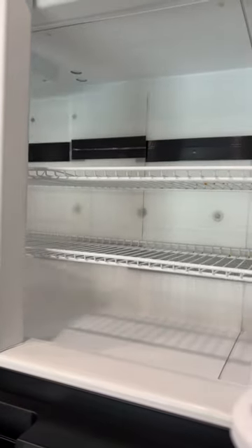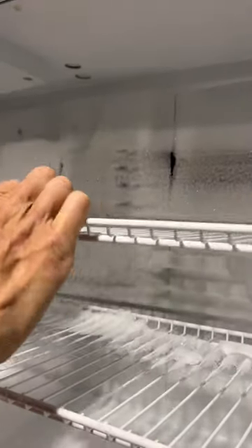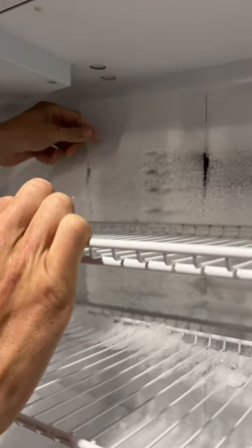On the bottom of the freezer, I just use single sheets. To hold the back ones in place, you just push the shelves back, and you're ready to defrost next month. You pull the shelves back towards you, slowly peel the sheets off, the ice falls right off, and the job is really easy.